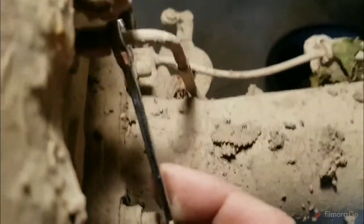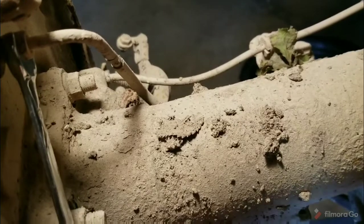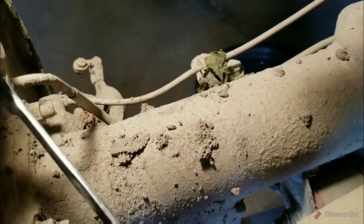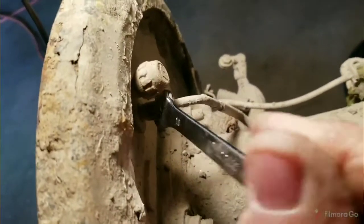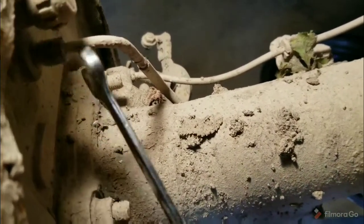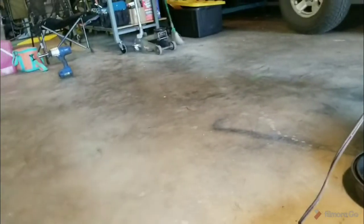When it comes to breaking the brake lines loose, I don't really like line wrenches so I'll just use a regular open-end wrench — it seems to work most of the time. You want to make sure as you spin that the line breaks loose from the fitting on the end, so the fitting spins and not the line, otherwise you're going to twist your line. It hasn't been that long since I've been in here, but you can spray them with some penetrating oil and that'll help.